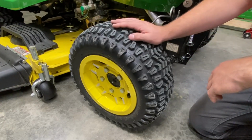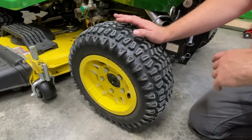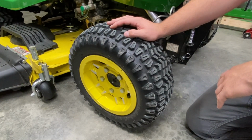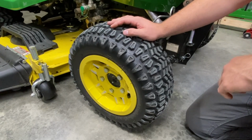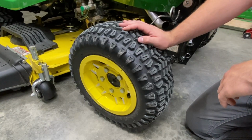Now, the better turf tire that I showed you, that smaller one there, that more premium version, grip's a bit better, but I think for the rear of your tractor, you're going to want something more like this. These tires, I have not had to slip at all. I have mowed a very overgrown yard, and then mowing around the septic tank area. Let's see, it was near the end of fall. The ground was really wet. Grass was still wet from morning dew, and it was primarily shaded all day, so it doesn't even really have a chance to evaporate. It was a pretty cool day. So I didn't really have a choice, and it was one of my buddies. They needed the yard cut, but the 580 was able to walk right up their septic tank mound, no problem, not a single slip. Didn't even have to use diff lock.